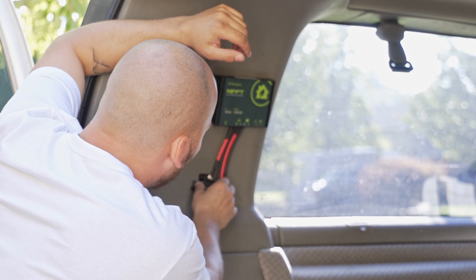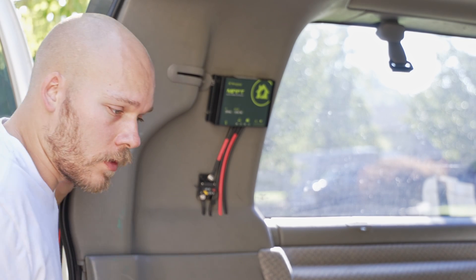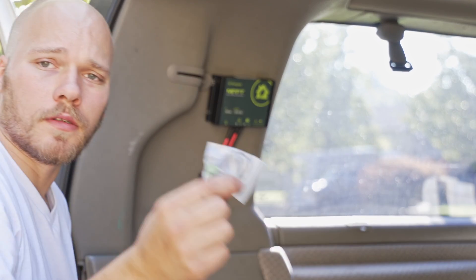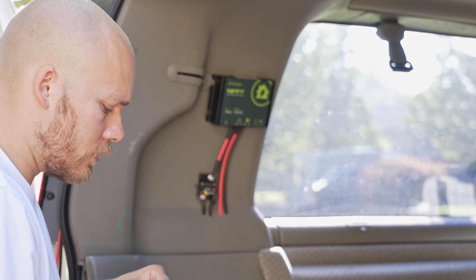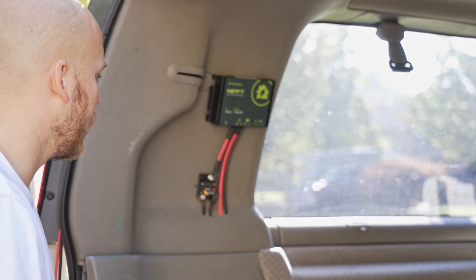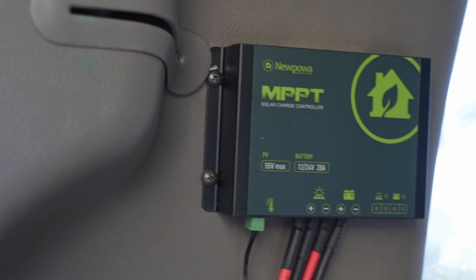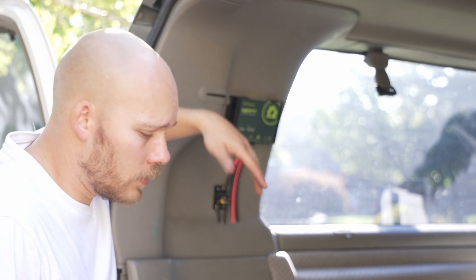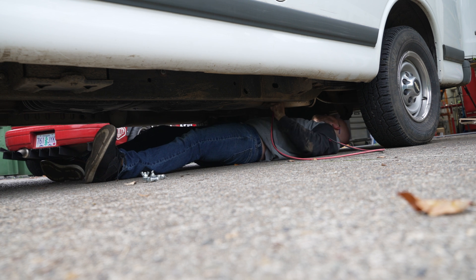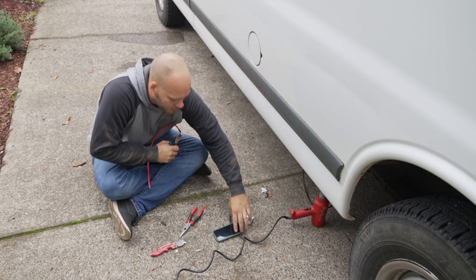So we're going to put a couple more screws in here, then finally fasten everything down. This is pretty much installed. There's one little piece I need to plug in here — this is the temperature sensor. This is just so the solar controller can know what the ambient temperature is and make little adjustments in order to protect the battery. Now all that's really left to do is run the wires over to the battery and connect them, which is mounted in a factory GM battery tray that bolts to the frame rail. Make sure when you do this, you wear some safety glasses, particularly if you had just recently been driving your vehicle on some dirty, muddy roads — you will definitely be dropping junk and gunk down into your face while you're climbing around underneath.